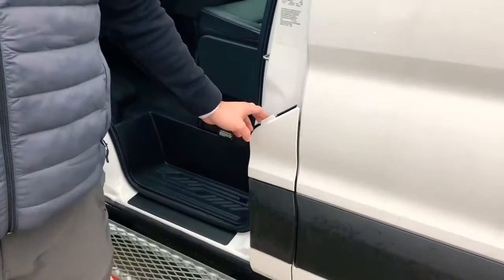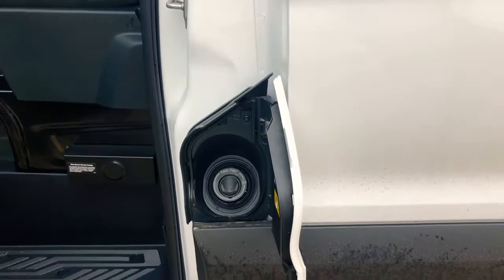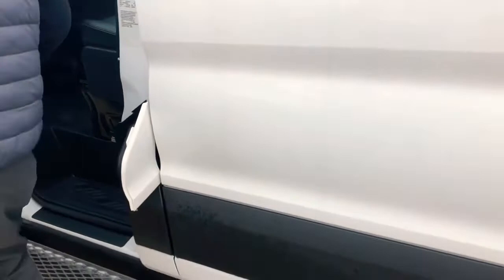You need to have the door open to access the gas door. It is a capless refueling system. The reason I'm showing you this adapter is: if you ever run out of gas and need to use a gas can, you must use this. Without it, not a single ounce of gasoline from a gas can will make it in, because this depresses and pressurizes the capless refueling system in order to allow fuel in.